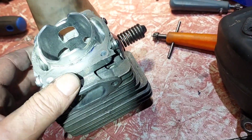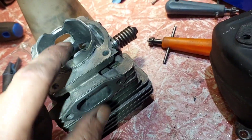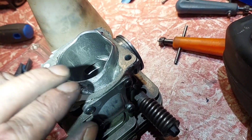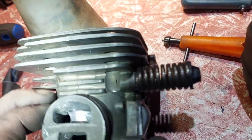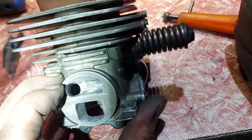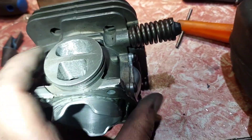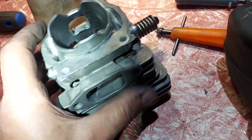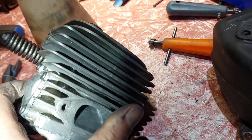I've dropped the side skirts just a tiny bit — about half a mil both sides. On the piston, you can see the way the gates open on the piston sides. I've also opened the upper transfers up here on both sides, more of an angled edge for better flow. That's all it was really — it just couldn't breathe through the exhaust, so that was the reason it couldn't rev.